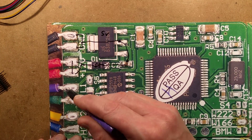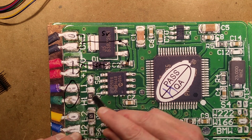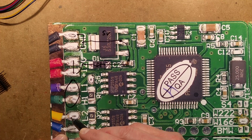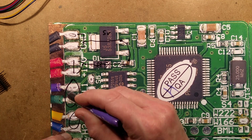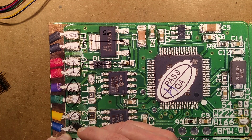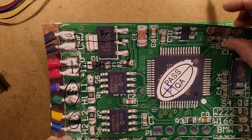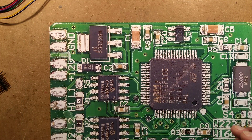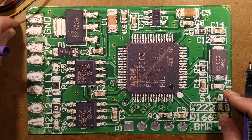This pair here — purple and green — is going to one CAN chip, and yellow and blue are going to the other. So this is from the ECU side, and this is going to the instrument cluster. This picture here is slightly bigger and useful because it shows the colors.